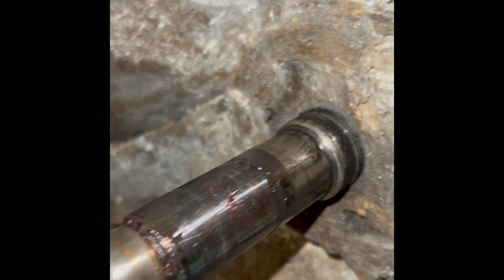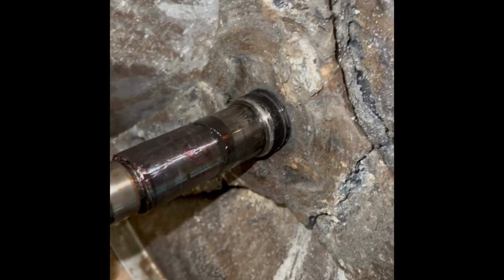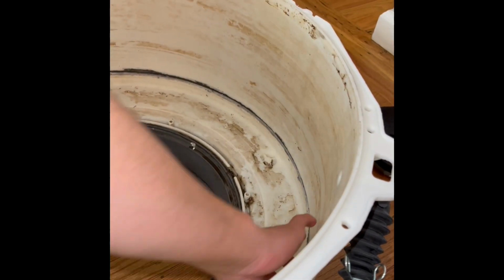time. You get a lot of micro cracks, and then if you get something heavy in the spin basket, like a blanket might do it, it'll crack, and then when it cracks, the spin basket is no longer really supported, so it clanks around and makes a bunch of noise. It also kind of tears into the plastic tub, but that's usually repairable.